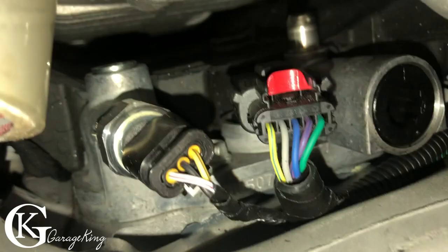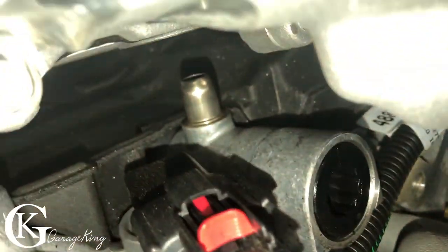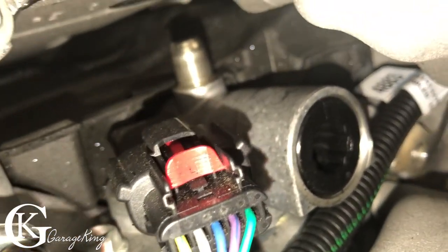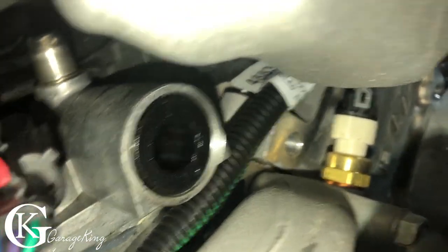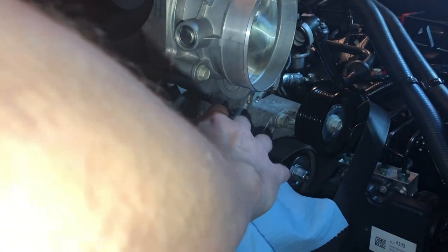And I noticed there's this black stuff under here. There we go. All that black stuff under there. And I think that's a type of insulation or something, maybe to make it quiet. So it'd be good if we could get that out, but there's no way to get that out without taking the supercharger right out. So that's a 14 mil there. And I have a long Allen key. So I'm going to use it for that, to get that out. So let's put this around here to protect our idler.